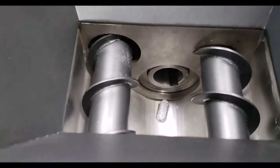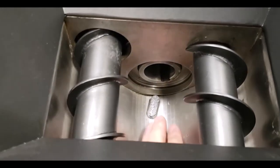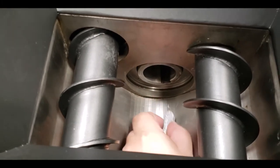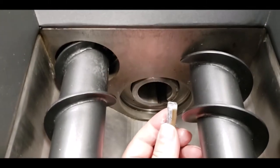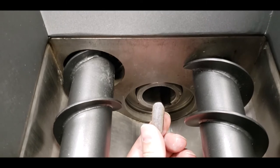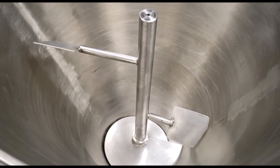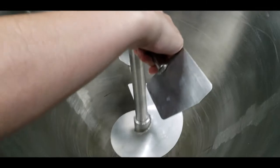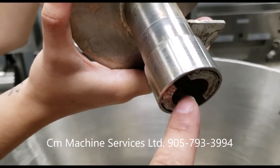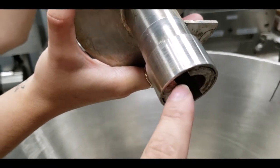Now you can clean the rest of the dough chamber. You'll notice there's a keyway that came out from there. This is one main part that you need to be careful about — this was done on purpose so that you can see that this keyway is easy to lose. Don't lose this keyway when you remove the black screw. This is where the keyway goes on the black screw. We're going to show you how to remove the screw — you're going to take it and twist it so that it comes out of its keyway and then pull it up. When removing it, you've got to remove it out of this slot here, and when putting it back in, you've got to make sure that it falls into this place in its slot — keyway.